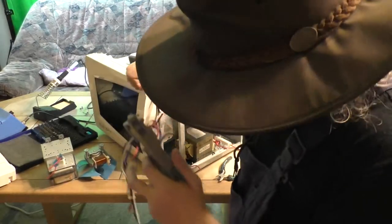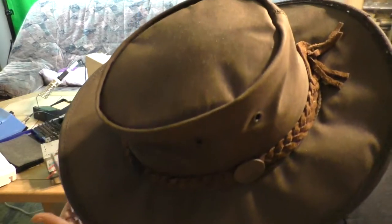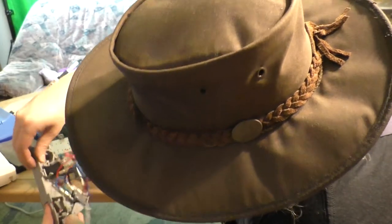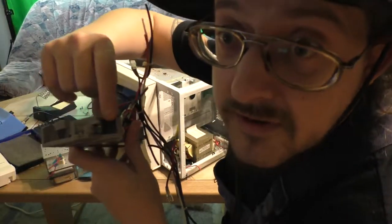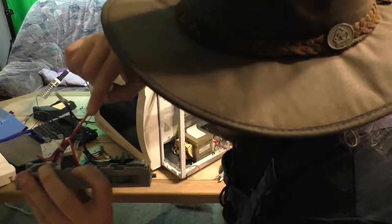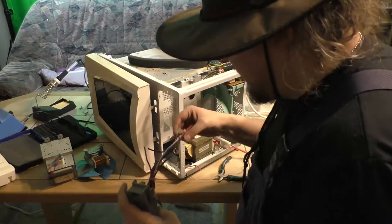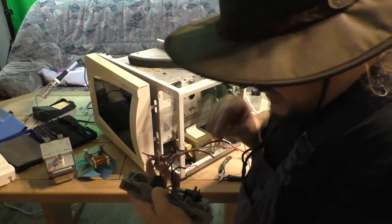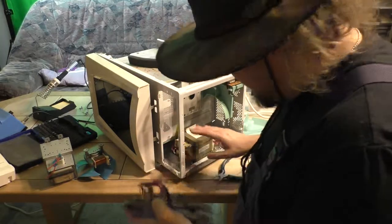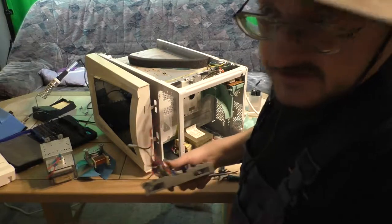the microwave is safe. And okay, there are actually three switches. And they all need to be closed, because there are two here on the lower end, two here, and one here, and they are all in series. And if one of them doesn't close, the microwave thinks the door isn't closed, and it just doesn't start. Not sure now about the cabling, because, yeah, well, I cut it, but I think all these three need to be closed before the high voltage transformer gets power. So nothing works if the door is open or if one of the switches is dead.